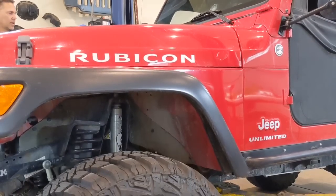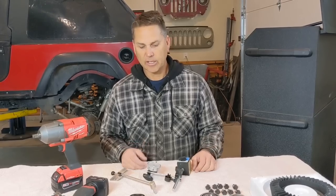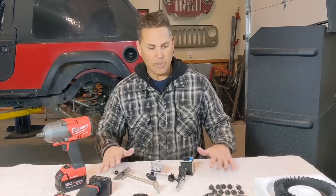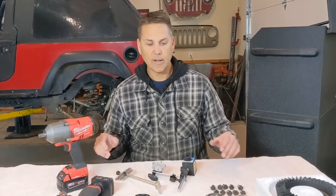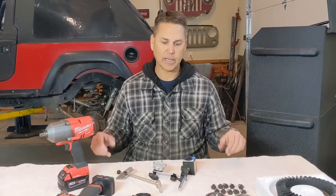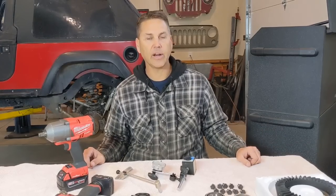I get a lot of comments and emails from people asking for a deeper re-gear video to help them understand things. This job is slightly different because we have a Rubicon with the standard Rubicon locker. The gear job itself is the same, but putting that locker in is where the difference is. I always like to start with a very clean environment — I put a towel down on my welding table because I use it for grinding, and the last thing you want is grinding dust on your bearings and gears. The towel also creates contrast so it's easy to find small parts.